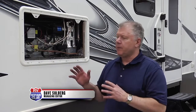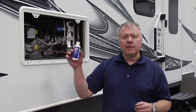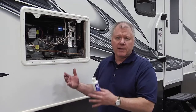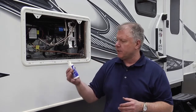If you've replaced any of your LP appliances, tubing, hoses, anything like that, or you suspect there's a leak in the system, there's a few things you can do to check it. A leak detector solution like this would just be applied to any of the places — especially if you replaced the tubing or cleaned the burner assembly out in your refrigerator, you definitely want to make sure you tested all those for leaks.